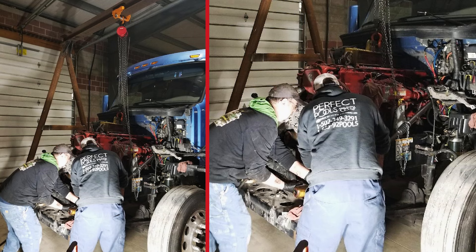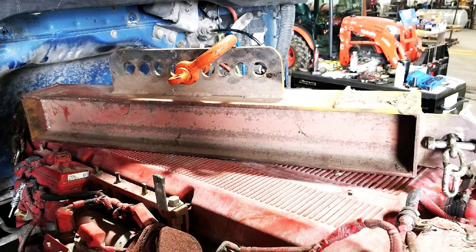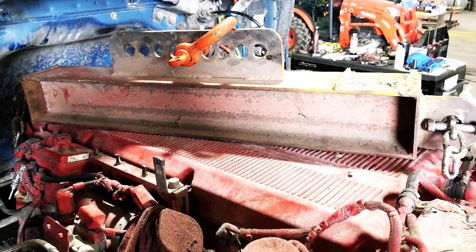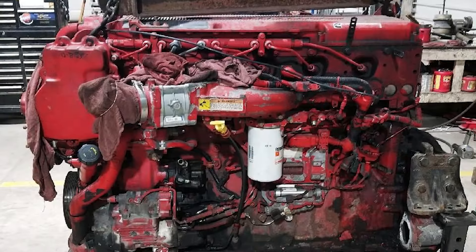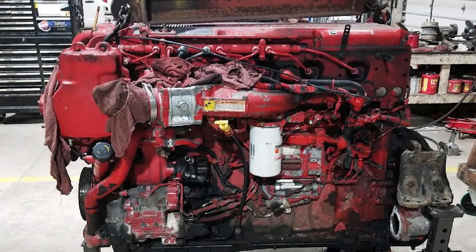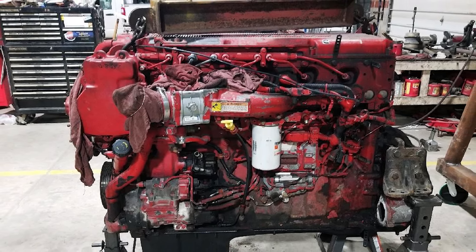It's a 2015 with about 990,000 miles on it. Not quite certain what happened, but it dumped coolant into the oil pan — why is still to be determined when we come apart with it. It'll be a post-mortem, looking for what failed, see what we can learn. I'm assuming it must have blown a head gasket internally — that's just an assumption, because it didn't put any coolant to the outside of the block.